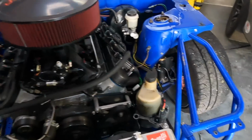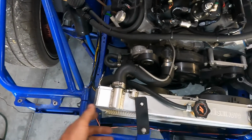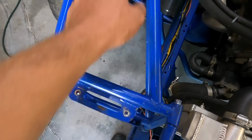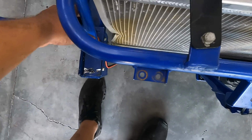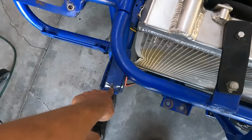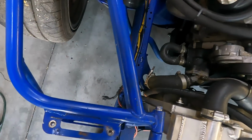These are crooked because the whole thing is bent this way, so that's probably the reason, I would guess. I don't know. They're really not even that crooked, so not too bad. This may be a little bent right here, but unbolted these, and this is where it broke and pushed in. So this is the tube front end from Chair Slayer, and the bolts are the shear point. It broke, pushed in the radiator, and that's what got it. So really not so bad.